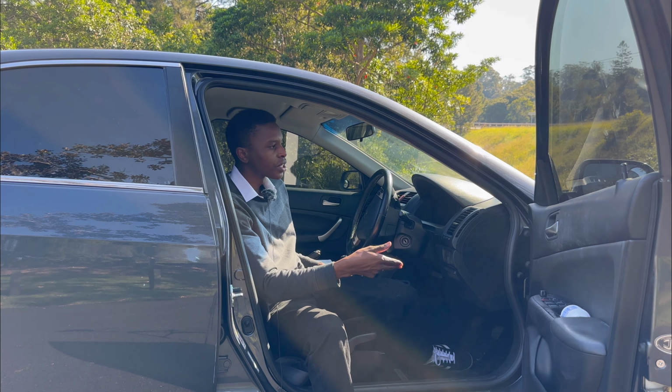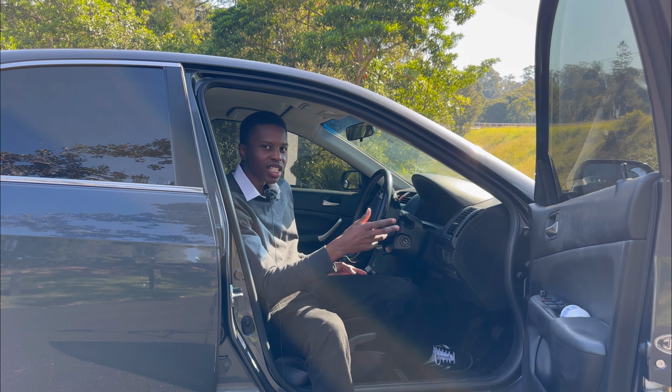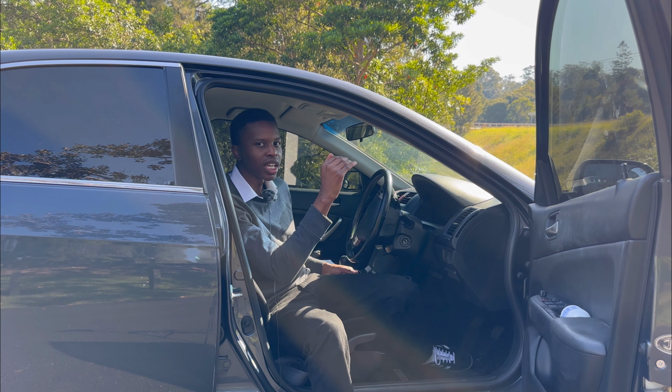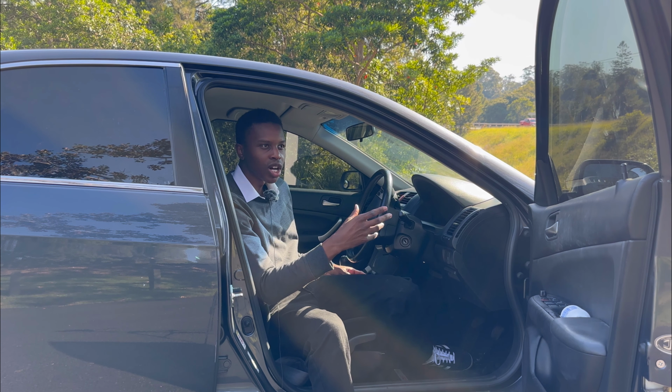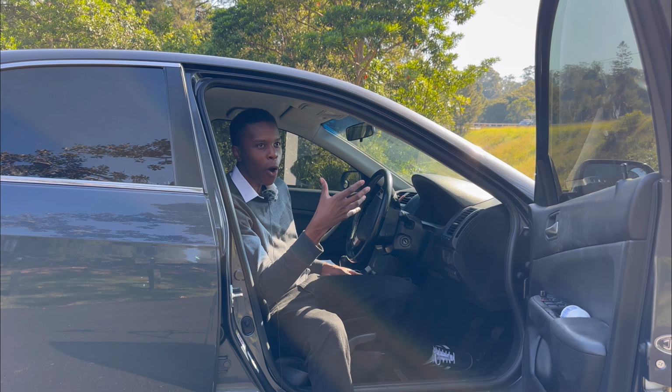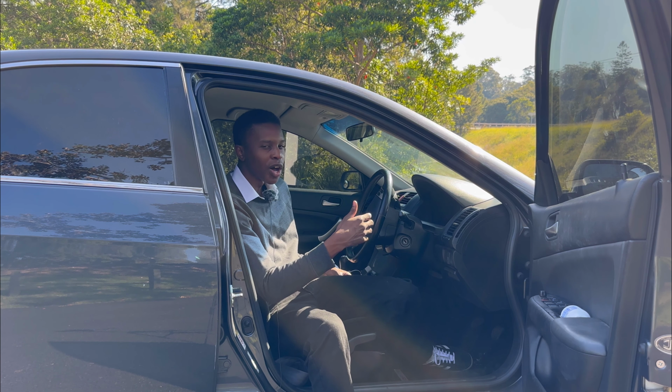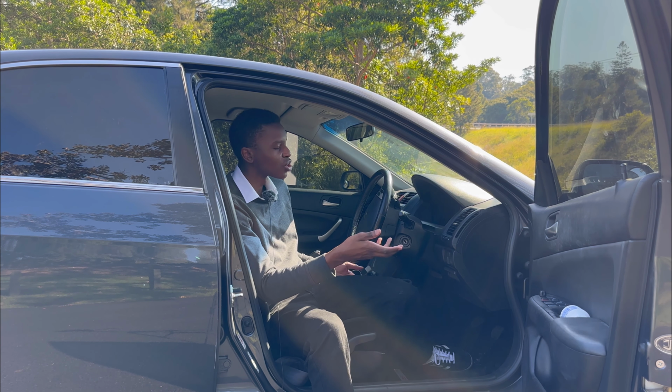Now, brakes on this vehicle, nothing special. I'm running DBA T2 rotors with Intima SR pads. These are pretty good, don't get me wrong, but I think in the future it will be due for a CU2 brake kit upgrade. That essentially increases the diameter of the brake, and instead of having a single piston caliper, we then have a dual piston caliper. So that really helps with stopping power. It's like a night and day difference. Having that attached with new brake pads really helps transform the car. It just makes it so much better.